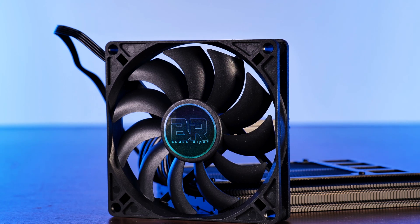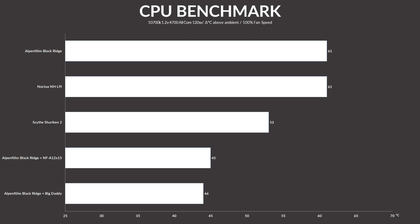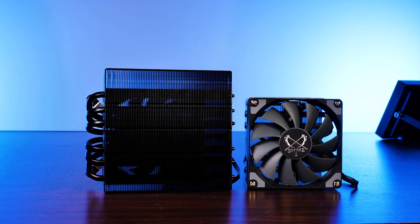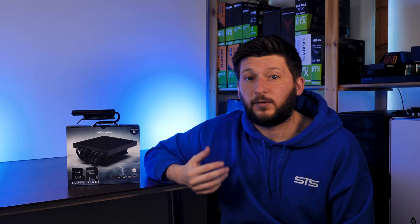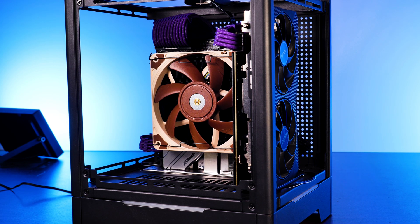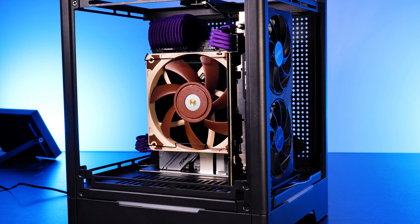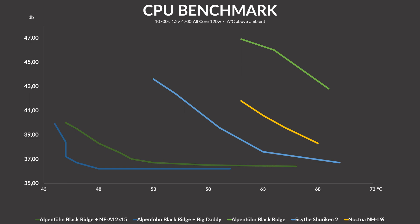But the major drawback of the Black Ridge is really bad performance out of the box — in other words, this fan. After having the cooler for a couple of weeks, I absolutely do not recommend getting it as an out-of-the-box cooler. Looking at the benchmarks, this is just bad. Knowing that the Shuriken 2 is smaller, has better RAM compatibility, and performs a lot better, I see no reason to recommend a Black Ridge over a Shuriken 2. But if you are okay with using up to 33mm high RAM and can fit a 62mm high cooler, this is an insane cooler — you'll just need to also grab an NF-A12X15 fan, adding to the total cost. But looking at those benchmarks, it's absolutely worth it if you have the space.